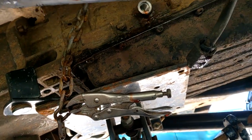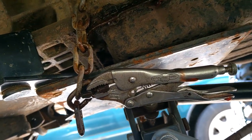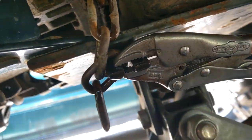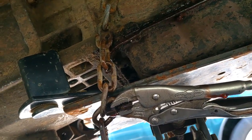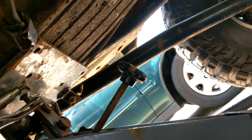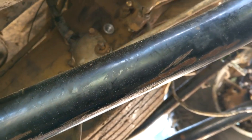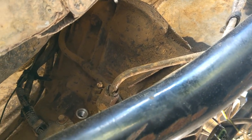Took a dinner break and it monsoon-rained - all the tools were underwater. Now for the fun part of actually getting the transmission out. Using the safety chain, I like to use a vice grip to clamp it because every time you go to take this thing out, the weight shifts, the chain gets loose, it falls off, and then you have no safety. Hook it down on the other side. Need to make sure the breather lines are unattached so we're not yanking them out, then take out the last couple bolts.